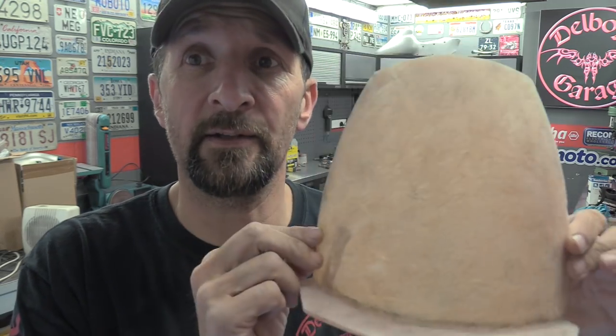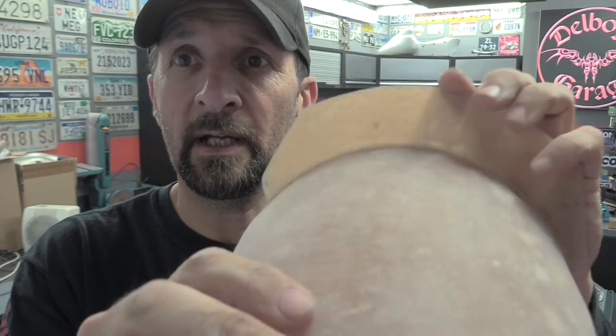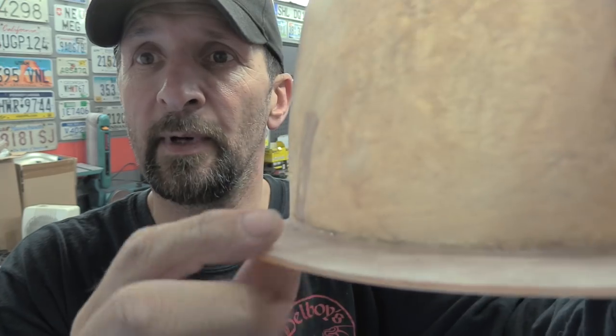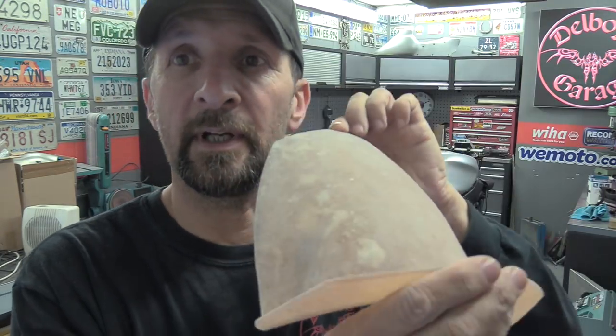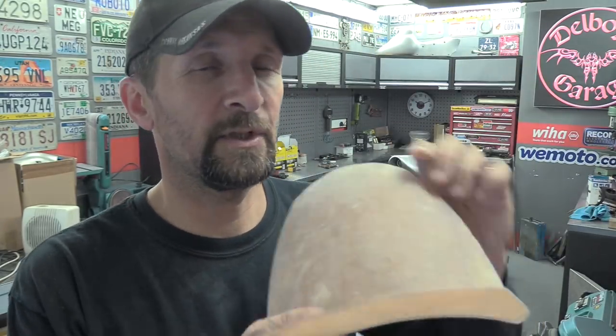All I've done instead, because I've got the luxury of that thickness, is I've just ground it flat with the wee sander, which is awesome. Including, which was really going to be a challenge by hand, that flat sheet along there, and underneath, which will be the mating surface with the swing arm, which is challenging because it's got a little notch in the middle I've got to deal with next. But there we are. All that needs now is a wee bit of dynaglaze and sanding and things. But first, it's got a little notch because that ain't going to fit right down in its position yet.